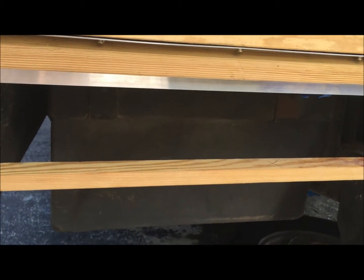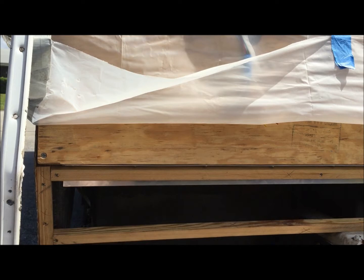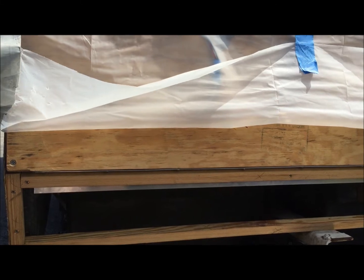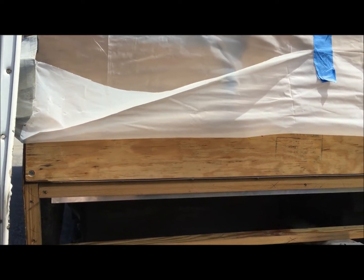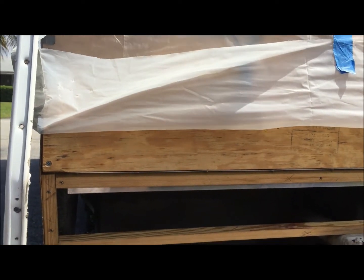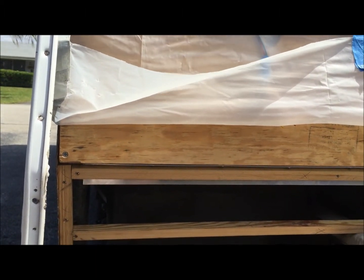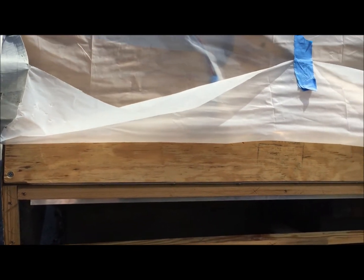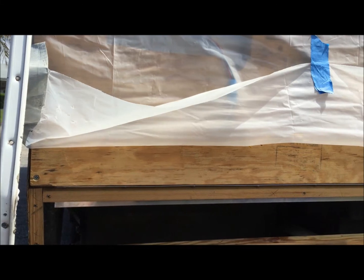I'm going to cut 2 pieces, but I'm going to take the inside of those pieces of 1/4 inch CDX that I'm going to bolt up to the frame, and I'll coat the back side of them with a light 2-part epoxy, just to seal them, keep the water and moisture out of them. I won't have to worry about the outside, because that's going to have the diamond plate over the top of them. It's just that back side where water splashes up from underneath and everything. So yeah, just put a real light coat of resin epoxy on there and get them sealed up, and I won't have to worry about them rotting out. Anyway, I think it's going to play out all right.